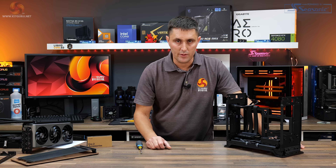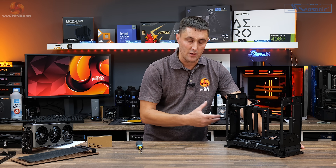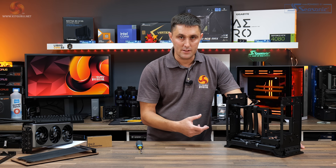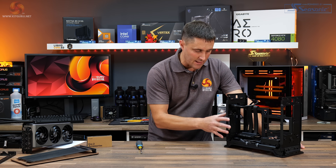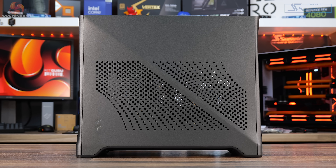You can also see the two floor fans installed working as intakes, which should provide cool air to the graphics card and improve GPU thermals compared to the original Fractal Era. In the original, the GPU was horizontally mounted, which was quite restrictive and limited the thickness and height of the card. In the Era 2 the GPU is now vertically mounted, giving more space for a larger card and hopefully improving cooling thanks to the two floor-mounted fans and the larger vented side panel.